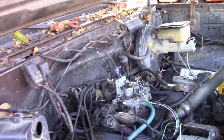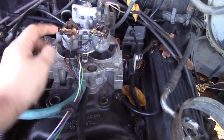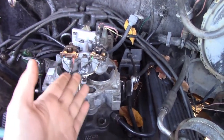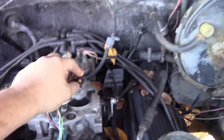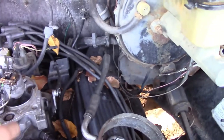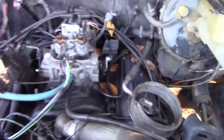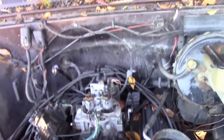That is the proper way to rebuild it, but what this thing is going to need now is new injectors. We're going to get two new injectors for it, and I'm going to take this bottom piece off and try to clean it up as much as I can — you saw how much rust was in there. I already replaced the top piece. That's going to be another video, where I'll talk about how to diagnose bad injectors, testing power to these, and a couple other things to see what your culprit may be. Thank you very much for watching and I'll see you on the next one.